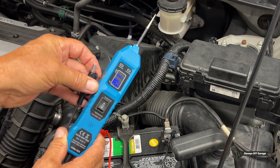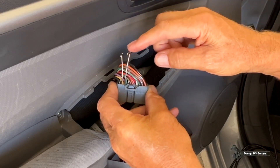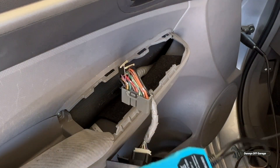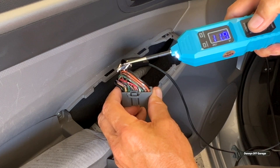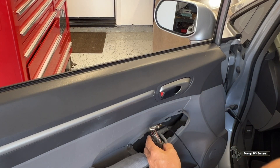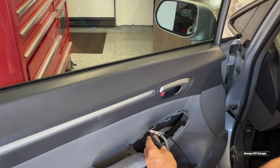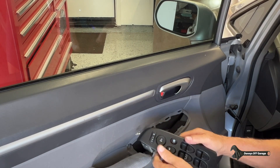Let me show you how I can use this to power up a window motor. I've got the window switch out — it's disconnected. I've got the T pins, and these really come in handy — I'll put a link to these in the description. All I need to do is take the auxiliary ground lead, put it on one terminal, and then power the other terminal up — and the window should come down. And it does. Next I'm going to reverse it and send it back up. So that just checked all my wiring and my window motor, and everything works good here. The most likely cause would be just a switch.